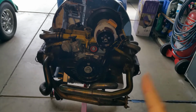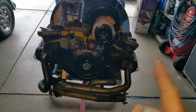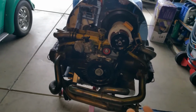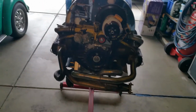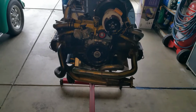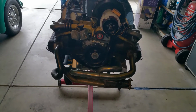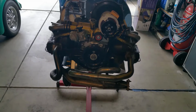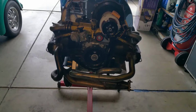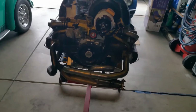And I wasn't paying attention to my oil temperature. And I was doing about 90, 95 following traffic, of course. That's just the way it was moving. And when I looked at the oil temperature, it was about 252 degrees of oil. And right there and then, I knew this engine was probably done. And I was right. She's done.